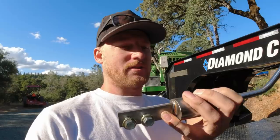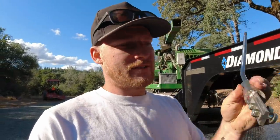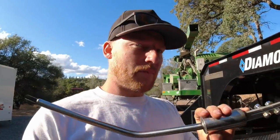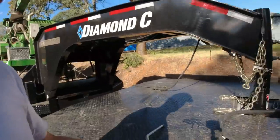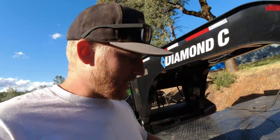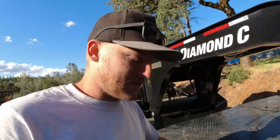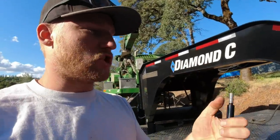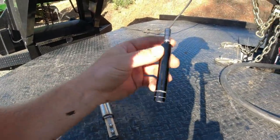As you guys can tell, it did the job fine — no real complaints on the motor functions. The extra leverage definitely helped. But since it doesn't have a rubber isolator, it causes a pretty aggressive vibration up the shifter that only amplifies at higher RPMs. It kind of makes my hand go to sleep because it's vibrating all the time, which I wasn't down for. And the god-awful noise it always produces just made me know it had to go. So I went ahead and ordered one of these — a three and three quarter inch, nine dollar shifter extension from Amazon. I actually ordered a couple because one was the wrong thread pitch.